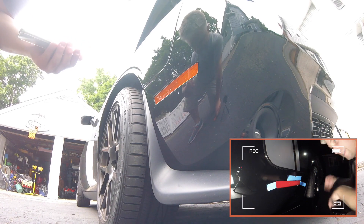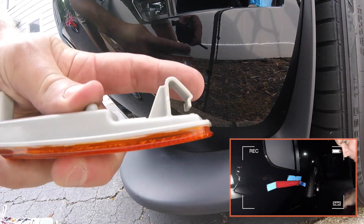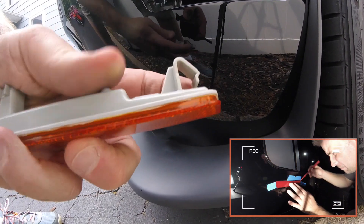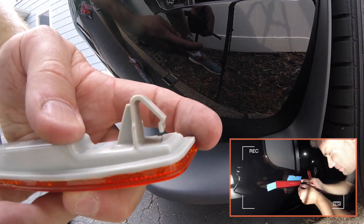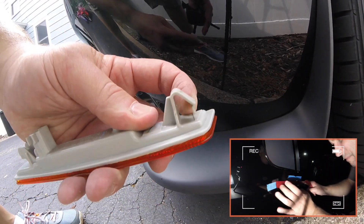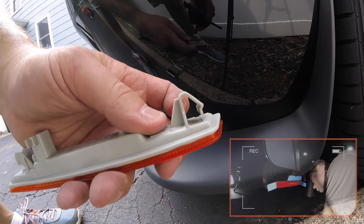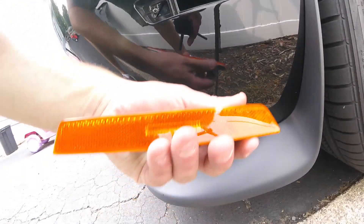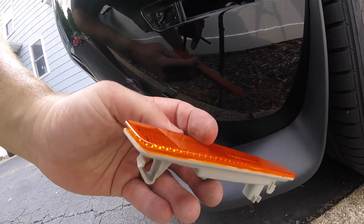What you need to do is go inside. This is the clip that I'm talking about right here. It sits locked in with this ridge right here, and if you use a tool to pry it out, what happened to me is it flipped over the ledge and then started ripping this off. The pry tool did not work. I don't know how much these things cost, but it's worth it to just pull that apart, reach inside, and do it right the first time.